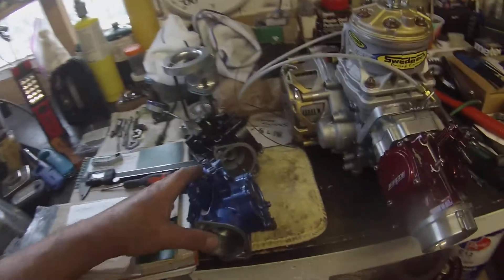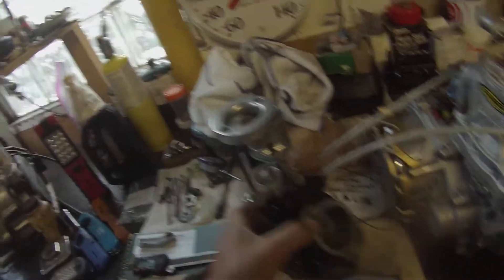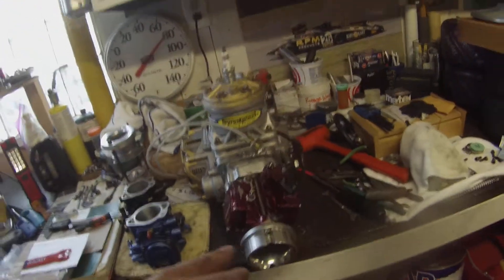How do you know the modified ones from the unmodified ones? Because the modified ones actually had a choke shaft and a choke butterfly in here. You can see this one's been DEVCON'd or filled up — I just put bolts in mine and Loctited them down, so they're plugged off. I'm a little freaked out about the filler getting sucked into the motor. But this one here, the choke shaft was never drilled — it never had one. So this one was a bone stock, unmodified carburetor. This is the second carburetor Rich bought, the first one he bought, and this is the one Francis bought. These are some manifolds over here for the Hondas, and obviously the carburetor goes in between with the long bolts.